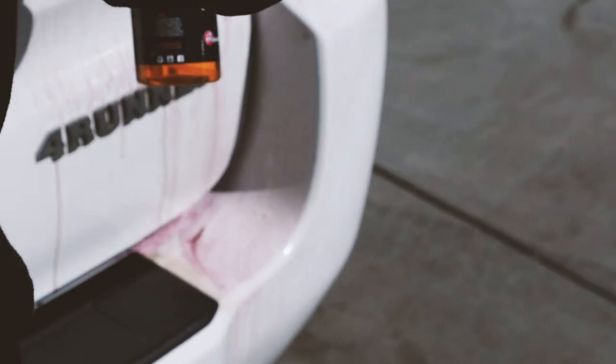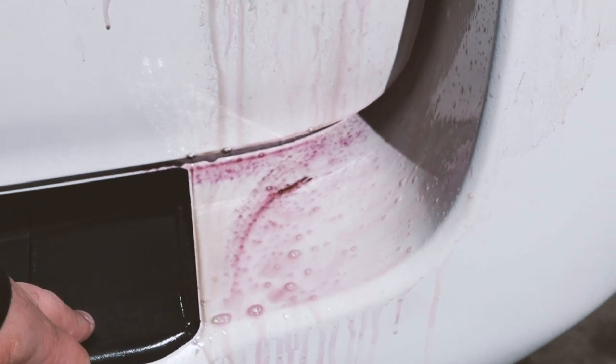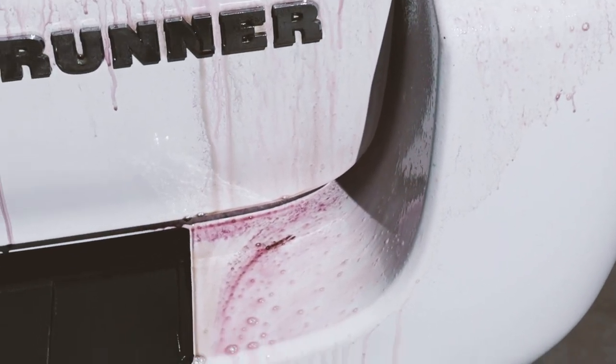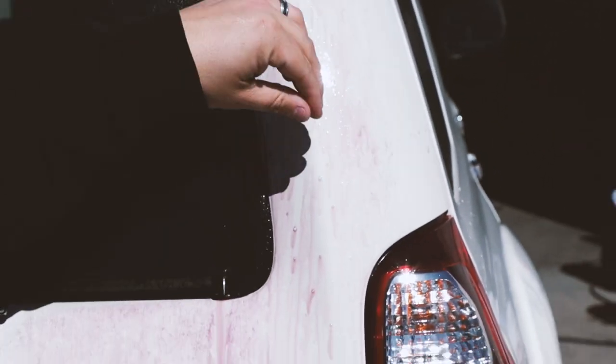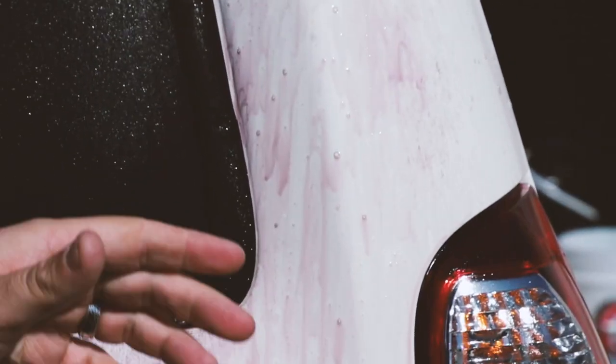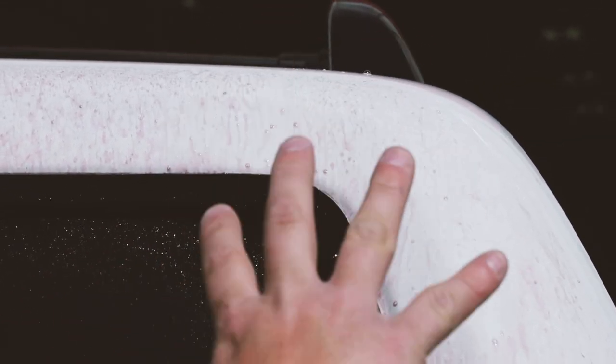I don't want to leave this on for too long either. Look down here — I mean that looks like I'm cleaning my wheels. Clearly I've not done this in a long time. But that's really what I wanted to show you — how the reaction of the iron remover and the bonded metallic particles embedded into my paint come together. With rail dust like this, it's usually more predominant on the back of your vehicle, and also on the sides and on the bottom — mainly where stuff gets kicked up onto the back regularly when you're driving.